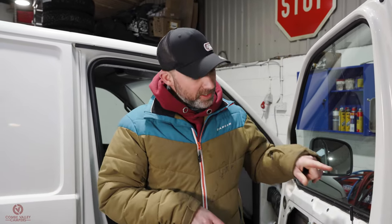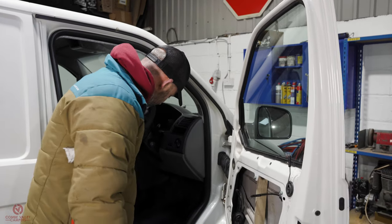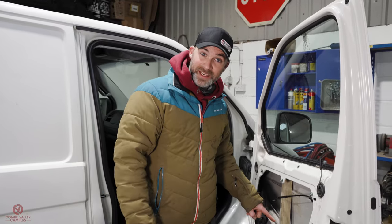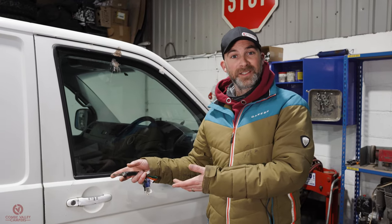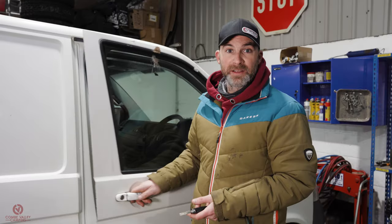Hi, Lee from the future here. Last time you saw us, we were in the van trying to diagnose the lock — there was a wire between the door solenoid and the body control module underneath the seat that wasn't working. We thought there was a break in the wire. However, after we finished filming and put the van back together — with a bit of wood holding things in place — I went to drive home, got home, locked the van, and this lock works now. I haven't done any trickery; all I did was put the van back together. It might have been a loose connection at the dirty body control module, or a door being open. But now it all locks and unlocks properly.